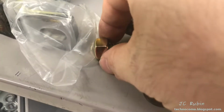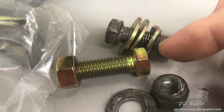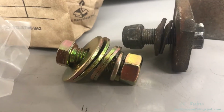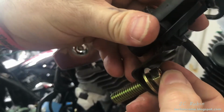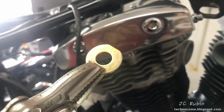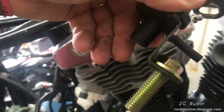And I'm already getting the replacements here from the drawers. We got washers and lock washers, bolts, nuts. Picked up some 1/2-inch washers as well. And this should be enough to get started. Putting this first washer around the VOES, I see that the washer is just a little too big. So I've shaved a small flat into it. And now it sits flush into the VOES bracket.